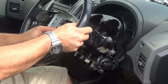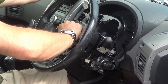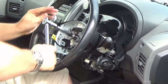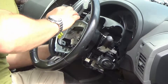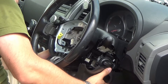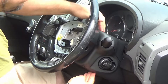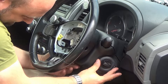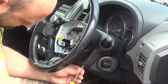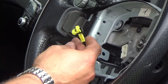Original parts cost a lot of money, so thankfully eBay had some cheap Chinese equivalents. The most important things are: making sure the wheels are straight when you do this, and that you put the clock spring back in a zero central position. They do normally come with a plastic clip so you can't mess it up — the one I got had that plastic clip broken, so I had to reset it by finding the center. At the very end you have to reset your steering angle sensor to zero, otherwise you get traction control lights and various other lights on. But I'm happy I got it fixed — hopefully this will be interesting and useful for some of you guys. Thanks very much, subscribe.